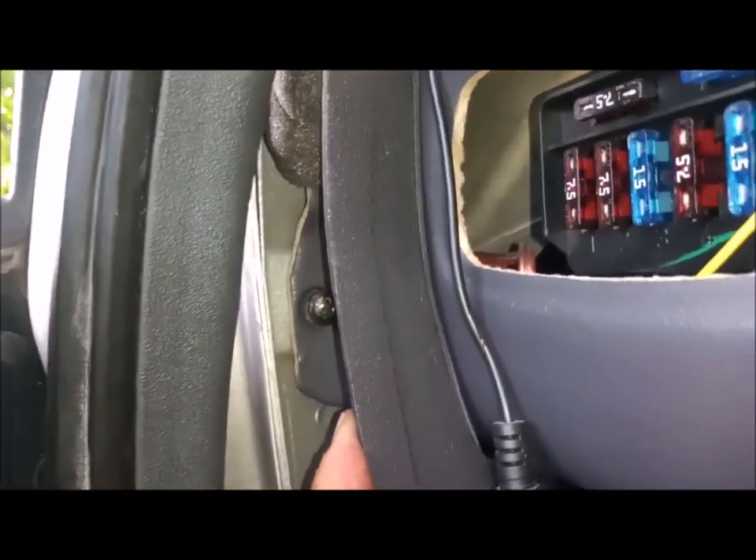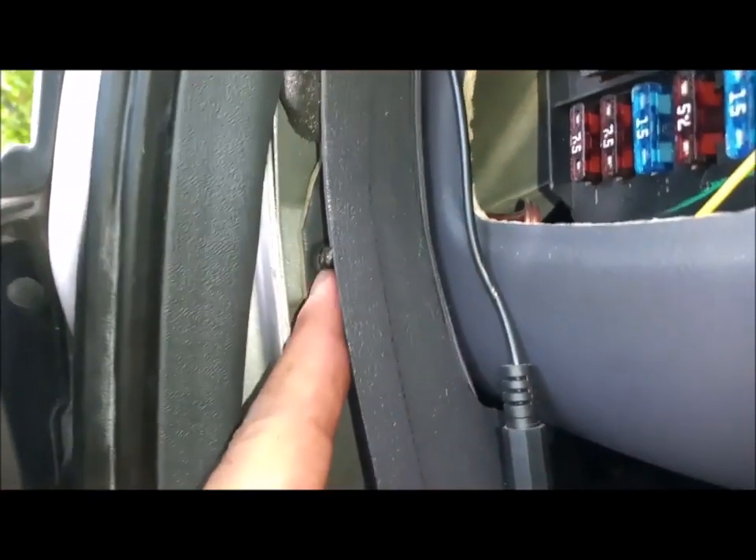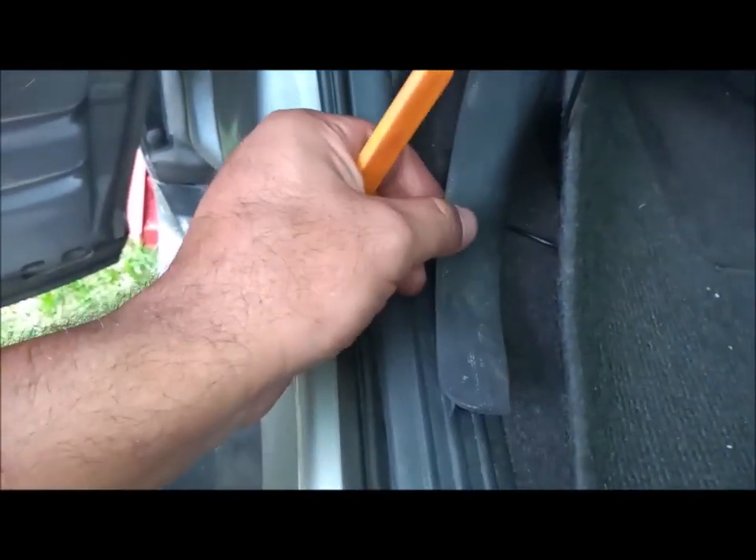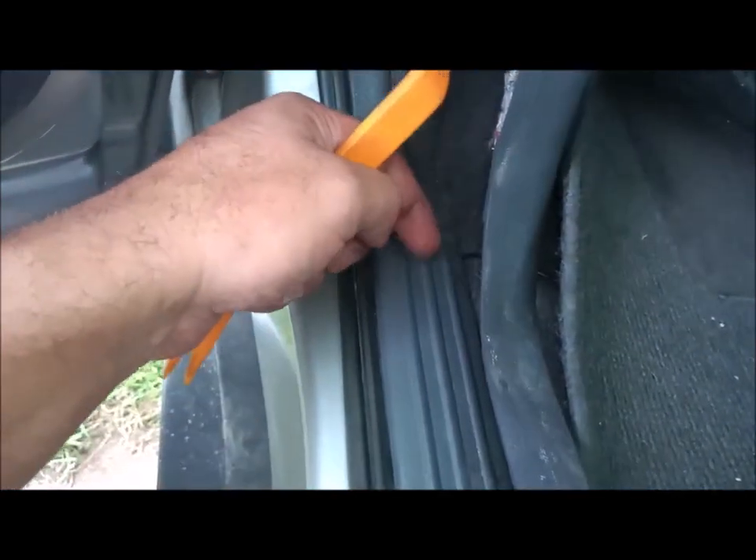After you remove this clip, there's a hidden screw here. You can find it at the same level as the fuse box — it's here, so remove this one. There's a small hidden cap — just pry it out — and a Phillips screw here too. Remove it and take it out. Now your panel is ready to be removed, except for this small clip hidden beneath this part. Don't break this one. What you do is just pry the panel a little bit, push this end backward — not outward, just backward — while raising this side, and take it out. Many people break this panel just because of this process.